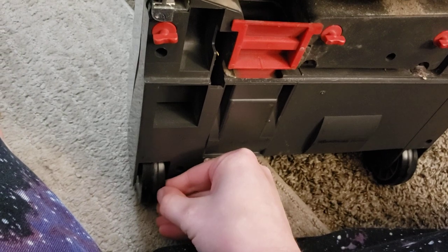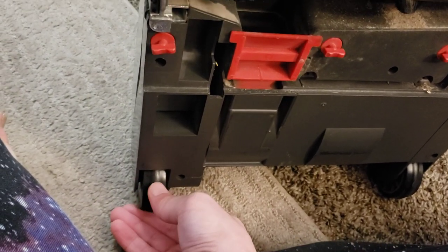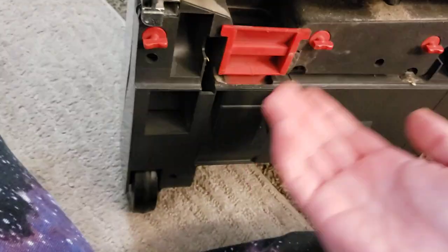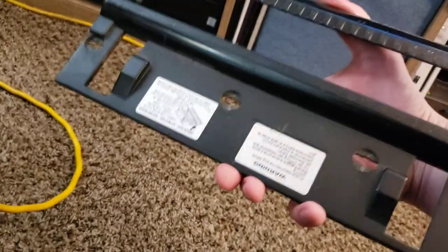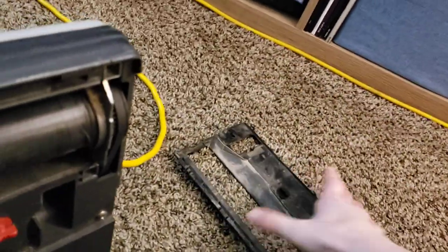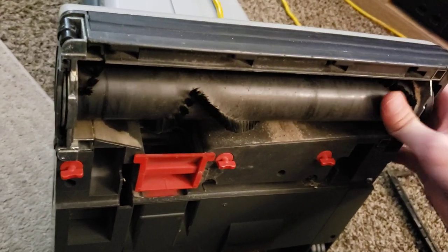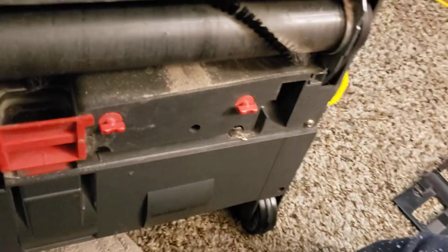The wheels are rubber coated, though they're not all that rubbery. It is worth noting that because this does not have a brush roller shutoff, it is not suitable for use on bare floors — there's not even a squeegee on the bottom to make it easier on floors. Bare floor performance is unfortunately very disappointing, which I'll talk about later. But the actual design of the brush roll for carpet cleaning and the build quality of this whole cleaner head is very good.